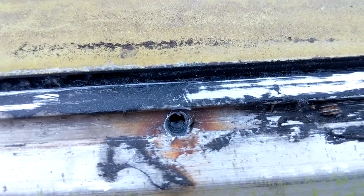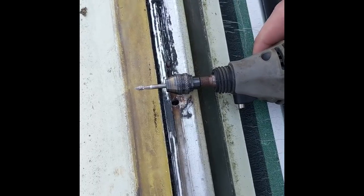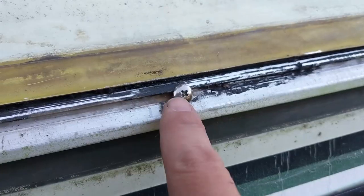By the time I got to the bottom of this hole I was only halfway on the steel bolt — the rest was aluminum that I had drilled out. Finishing out the hole with a die grinder bit on my Dremel tool. I think I can get the bolt in there now — that'll do.